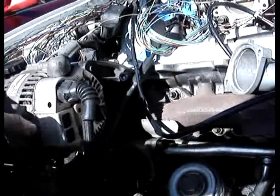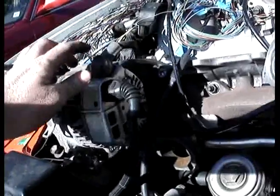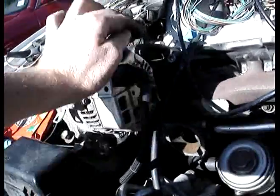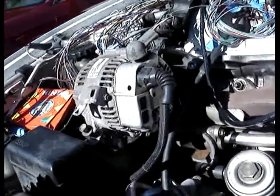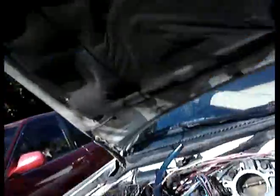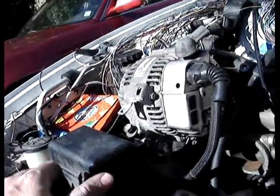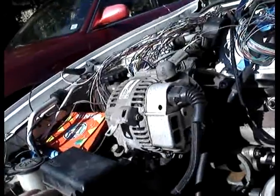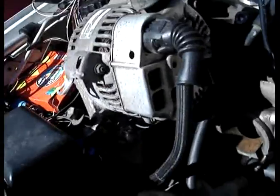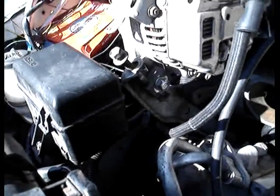None of them came to the U.S. unless you shipped it over. I used the alternator from a Camry, but the positive output terminal is on top, which means it bumps the hood padding. Eventually that would wear through if I ran it like this, so I've got to get another alternator. My Celica one would bolt into the alternator bracket perfectly, but it sounds like little mice chirping when I spin it, so I can't use that one.